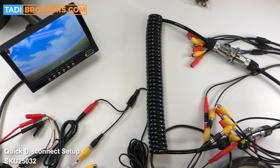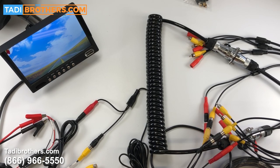Regarding other cameras: if you have a side camera or a license plate camera, the installation is exactly the same way — you thread the cable from the front of the fifth wheel to the location of where you're going to put the side camera or license plate camera. It's exactly the same process. If for some reason you have a five or six camera system, you might need to add an A-B switch. You would do that at the point of the monitor to connect an extra input, but that's a little more advanced — you can always call us and we will help you out.